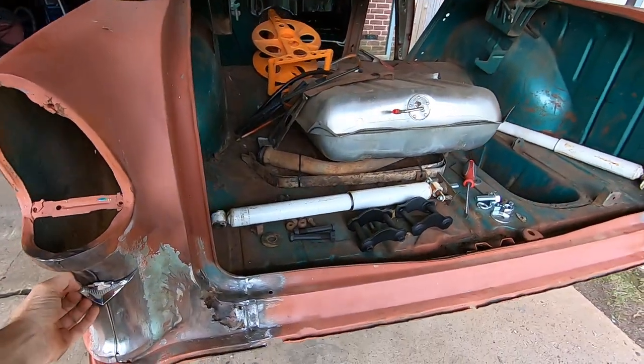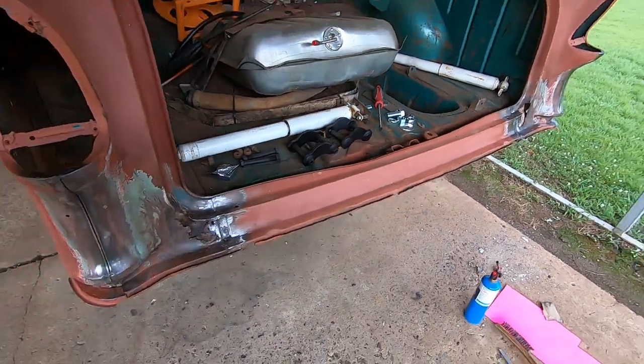Anyway, lots more work to do to the car, but I thought I would give a few tips. That's how I do my under-taillight V8 emblems on 55s. I just wanted to give a few little tips and tricks of stuff that I do. That dimmer switch — always get it for a 72 Chevy pickup. It's like 10 bucks at the parts store and they're always in stock because they fit all kinds of GM vehicles, and it puts the wiring on the inside of the car. Anyway guys, I'm going to cut the video off and clean up my mess because it's getting awful dark. Looks like we're going to have another round of rain. Thanks for watching.